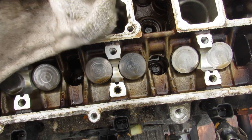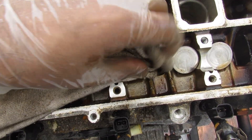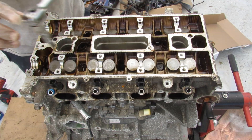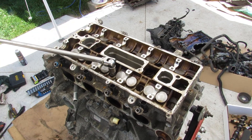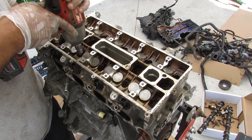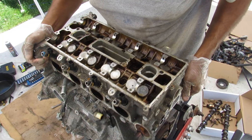Things are a little bit oily here, so I'll wipe this out so I can see what head bolts these are. It looks like those are Torx — actually a T55 Torx. These are on there pretty tight. I'm going to wind these bolts free now. I'll notice that these head bolts have a lot of sludge inside of them. Now I'll remove the engine head.